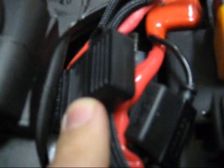From the positive side of the battery terminal, you've got the stock wiring running up to your starter relay. I tied in there a second wire, which is this thinner red one, and then that goes to a Radio Shack fuse holder. This has a 30 amp fuse inside. This again runs around to the relay on the switched side, so it only has power when the bike is turned on.